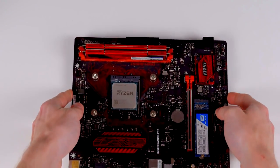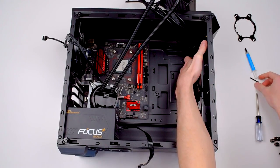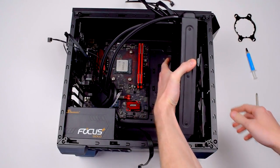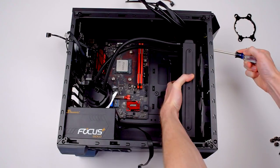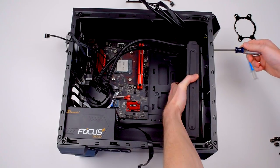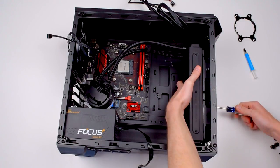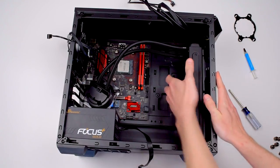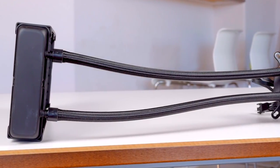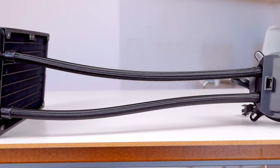Here's how I mounted the radiator and fans to the case. I first threaded all the long screws through the fans, making sure to keep the header wires clear of the front and backside of the fans. With the screws holding them in place, I lined up the radiator mounting holes with the exposed parts of the screws. Whenever you're tightening screws in a computer, you should always turn them back one quarter or half a turn until the threads click — this helps make sure the threads aren't crossed. Tighten down all the screws, no need to crank them down like a gorilla, and the radiator is installed. The coolant tubes are sleeved and 350mm (13.8 inches) long, which should be fine for the vast majority of micro ATX and standard ATX cases.